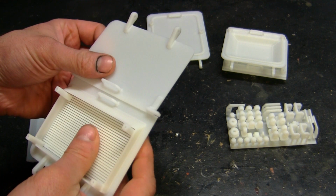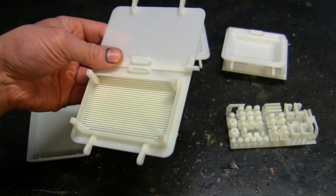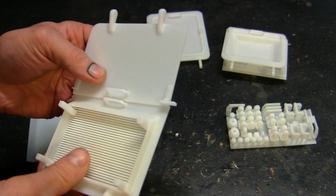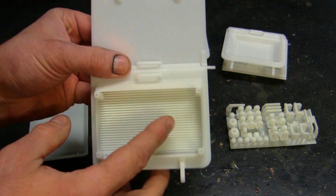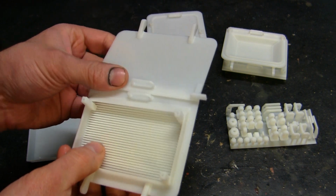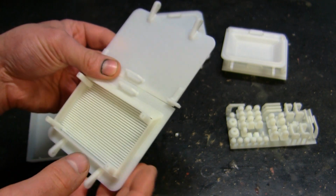Now, as a quick reference point, I actually made an error when I referred to something as the Pagoda in an earlier video, which was the exhaust, or I should say the blower duct. That was a mistake. In actuality, the Pagoda is this little section here on the rear engine hatch. The rear engine hatch on the V100 is another thing that went through a bit of research and development as the vehicle went through its production phase.